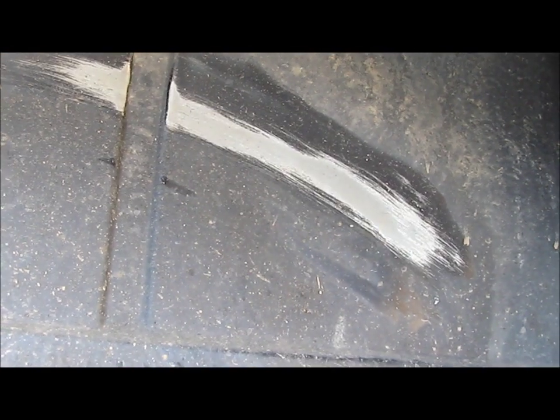You know, a little rubbing like this, that's okay, but more than that, to where you're actually putting stress on turning the wheels and you're making the truck fight itself, you don't want that. So a little bit like this is okay. And also, if it's metal versus rubber, metal usually wins. So you want to get it lined up right.